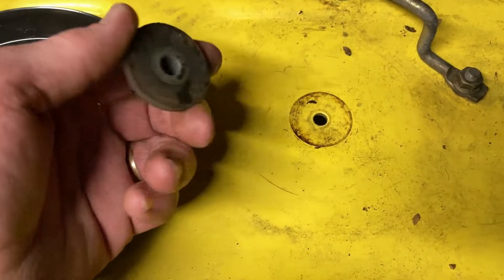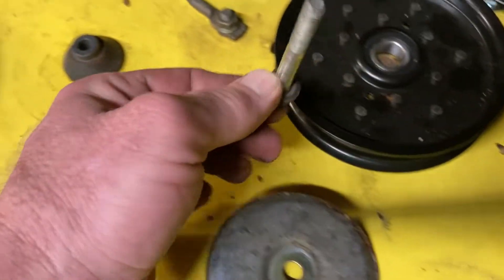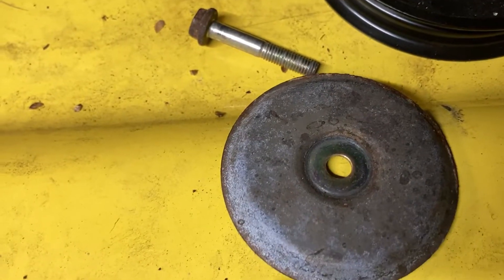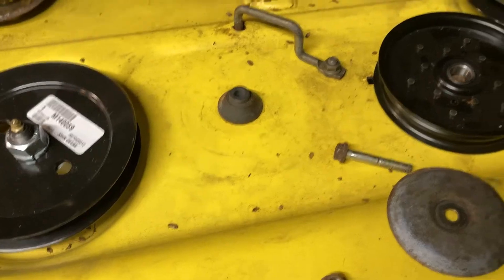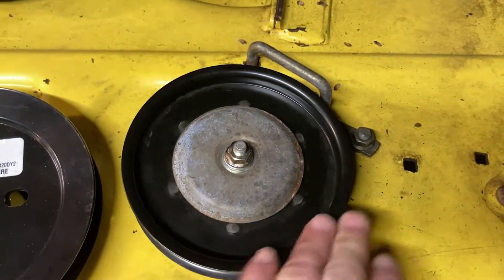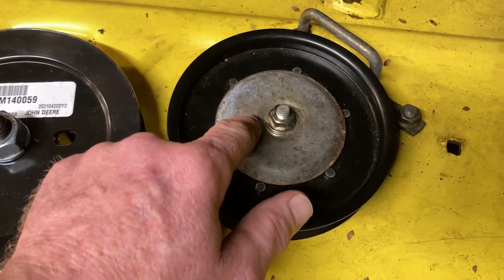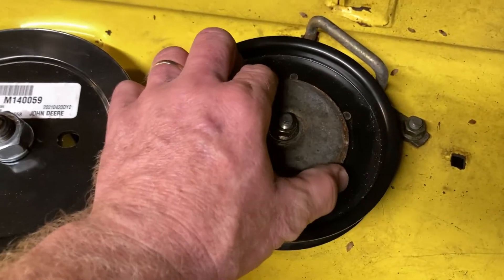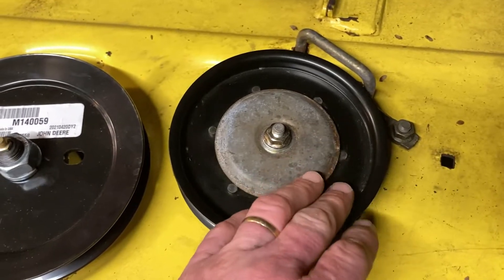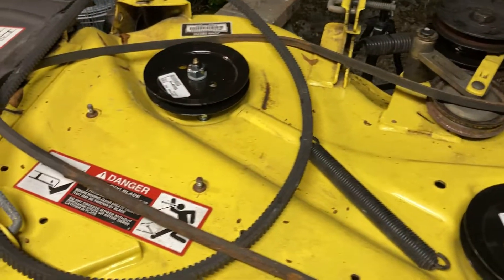The next thing to go on is the tensioner or idler pulley, which goes right like this. The bolt comes up through, and the size of this fits into there, and then this clamps over the pulley, and that is the nut that goes on top. I got this squared away — I needed to put a washer right below this item to make sure the pulley could spin freely. Before I fixed it, it was just clamped down to the pulley, which meant rotating one way it would loosen and rotating the other way it would tighten and the whole thing would move, which is not how it was designed.